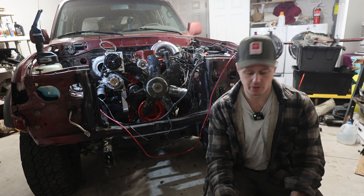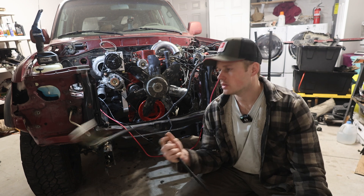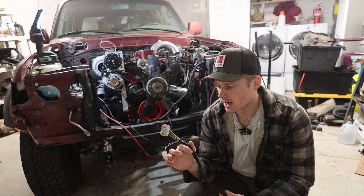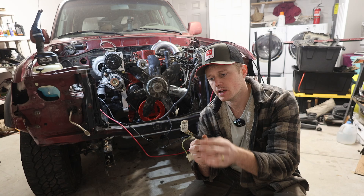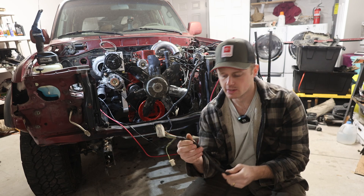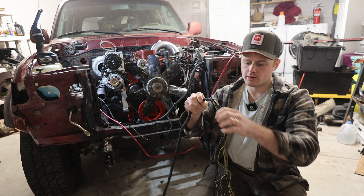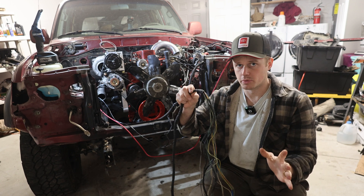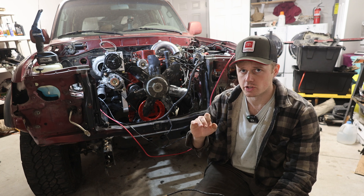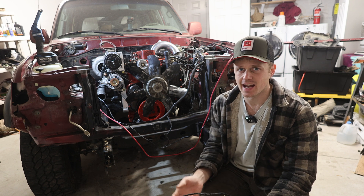We've made quite a bit of progress with the wiring harness — it's one of those things you just have to take your time with. You're left with two white connectors going into the cab: one for the coolant temp sensor and one that handles the transfer case detent, starter, and other functions. The harness is wrapped in friction tape with leads ready to wire to their locations in the engine bay. We are now turnkey — turning the key on activates the fuel injection plunger from the fuel shutoff solenoid.